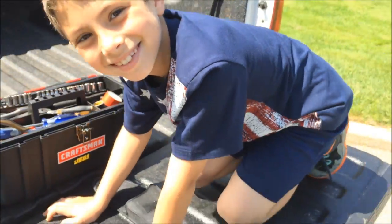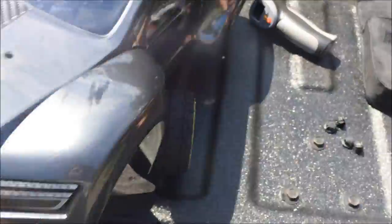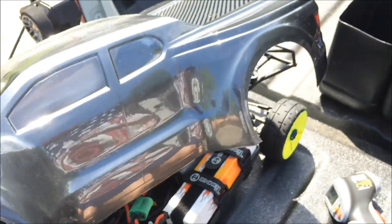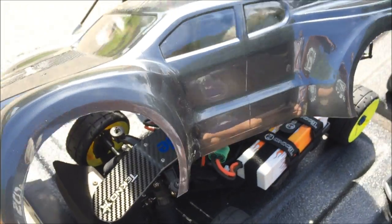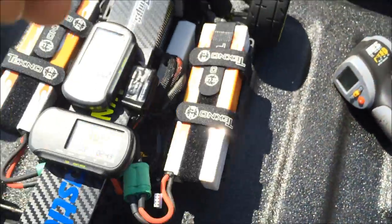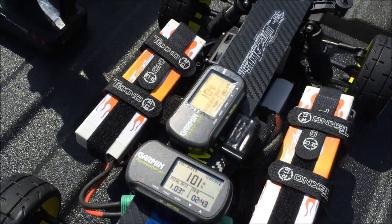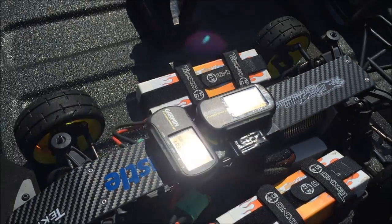This is the new body — scalpel body — which is destroyed. I was running it with the wheel wells on there but it was catching way too much air and we flipped over a bunch of times. I'll show you some of that footage, that was pretty crazy. But I trimmed out the wheel wells and I trimmed out the back and it seems to be doing a lot better. I was only able to get up to about 85 with the wheel wells on there, so now without the wheel wells we hit 104.